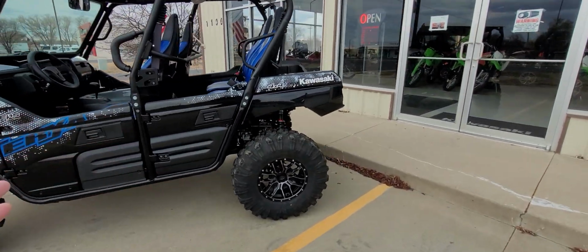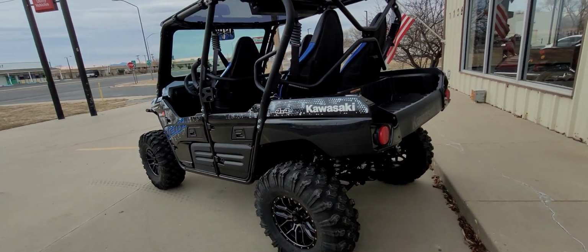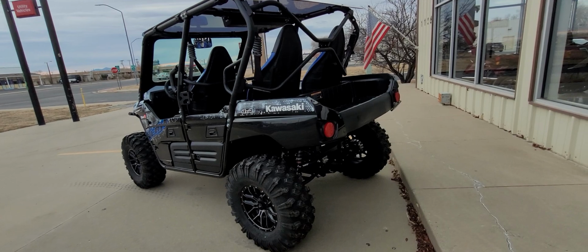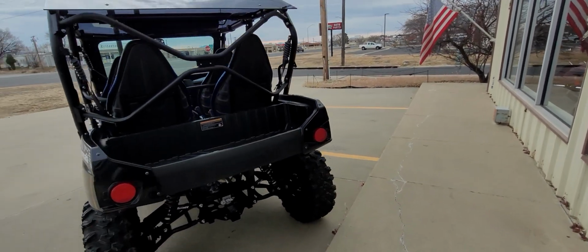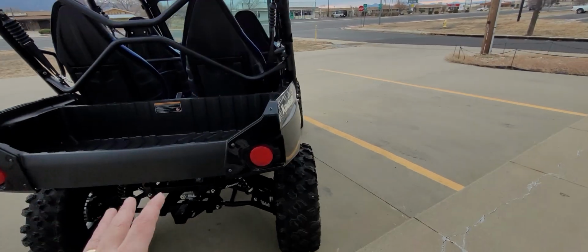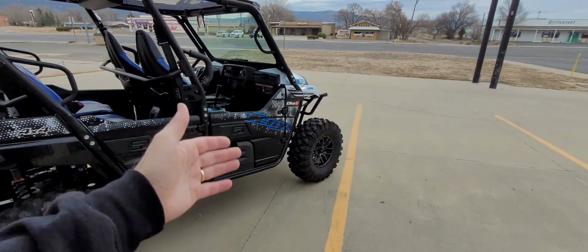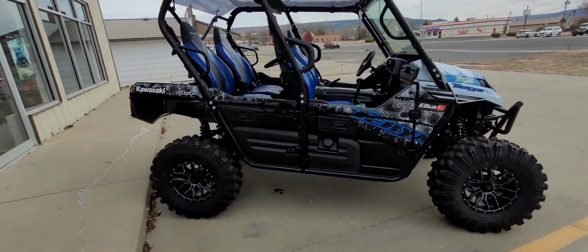Okay, so this could have 14 inches of wheel travel with this particular setup, but I've tested it at a 3.5 inch increase, 13.5 inches. I'm sorry, 11.5 inches. My bad. I'm bouncing around on different machines in my head, so forgive me. It starts out with 8 inches. We add 3.5 inches. We're at 11.5 inches of wheel travel. So it makes a big, big difference.